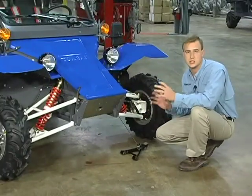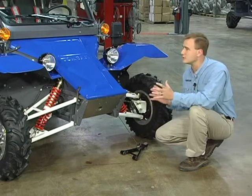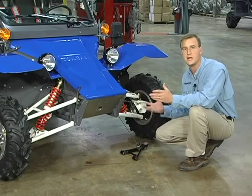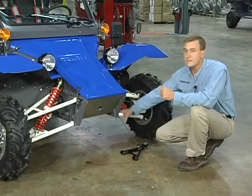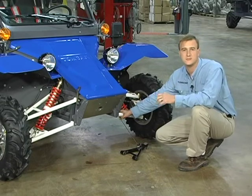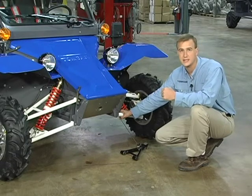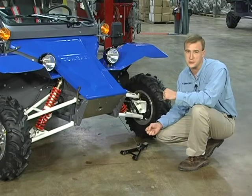The Tomcar was designed suspension system first. The benefits of that mean that the rest of the vehicle is designed to respond to that suspension, allowing it to carry the weight on the back of the vehicle and allowing the front to float over things. The A-arms are also made out of chromoly rather than armored steel, because chromoly is a little bit softer and has a tendency to bend on impact rather than break. The point being you can drive home on a bent A-arm, but you can't drive on a broken A-arm.